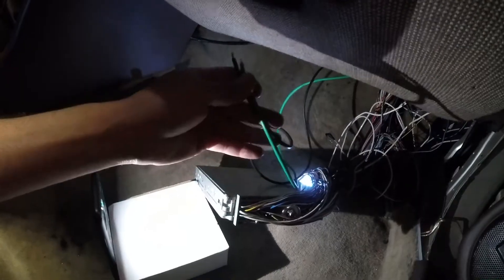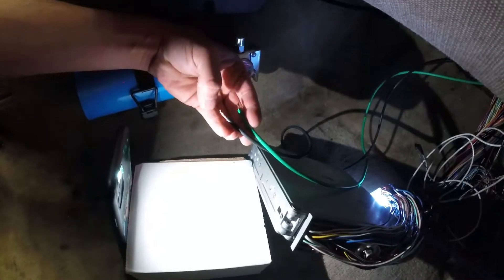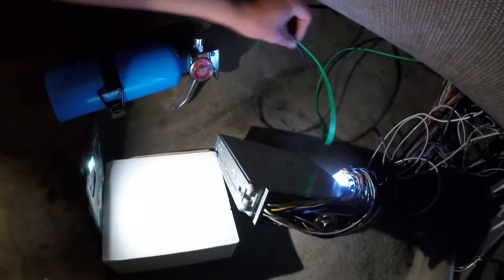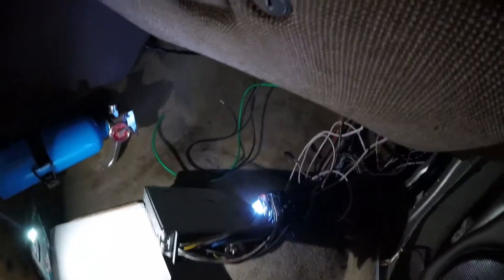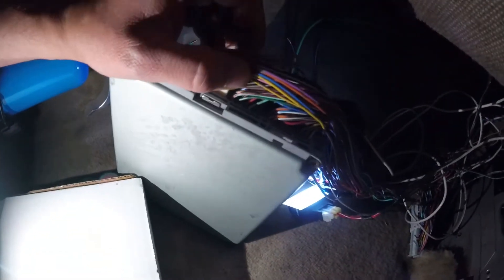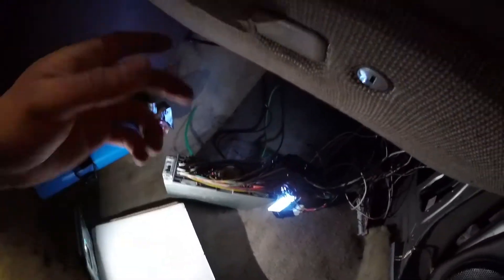I have that harness coming and we'll plug it in — we'll be running the AVC-R, but for now stock ECU. These two wires are from the intake air temperature sensor. I have them colored green and black just like from the sensor, so I know in here I don't have to keep looking back or trace the wires one by one. They're going to come into the ECU pins, and I'm waiting for the pins from Wiring Specialties so I can pin them in there, because the pins that came with it weren't correct.